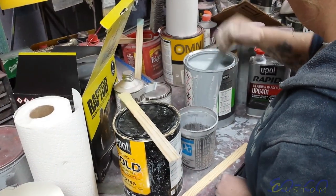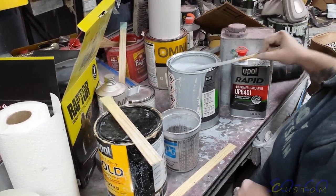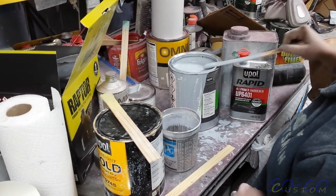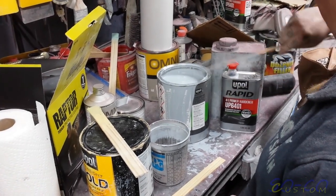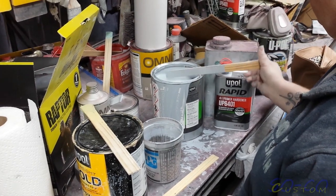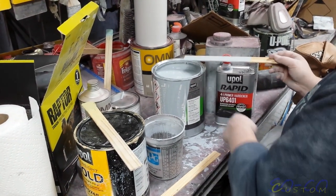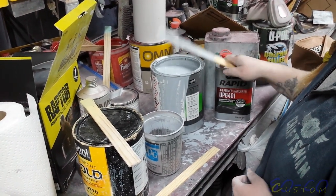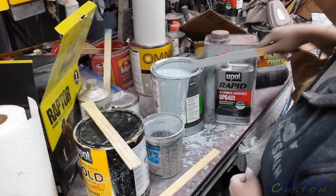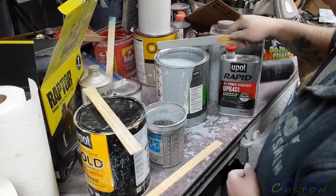Now, Bridget's just mixing the primer, guys. You want to make sure and stir it in the gallon. Don't just ever open them up and pour. But she already knows all that. Mix it real good. And what's your ratio to this, Bridge? This one calls for 4:1:1. But because the temperature is cold outside, we're going to go 4:1:1/2. Ah, okay. 4:1:1/2. Doing it outside in the driveway.